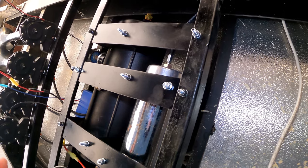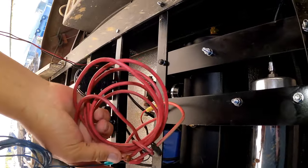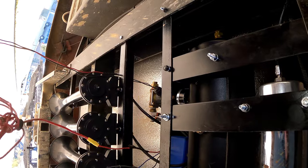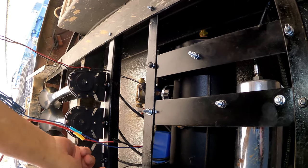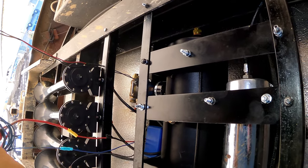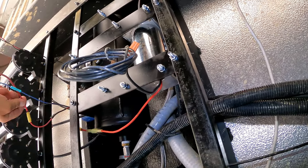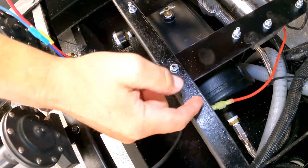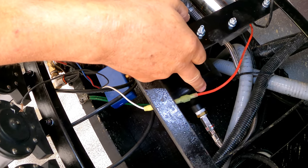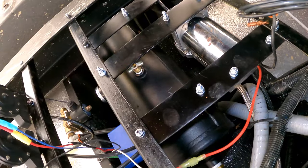Since it's a 12-volt system I really only need to run one wire for each thing. According to the schematic: red is the 12-volt positive, blue is the ignition wire so the compressor will not run when the ignition is off, and black is the ground. The power comes in and goes into the pressure switch — when the pressure drops below 100 PSI this kicks on, charging the system. Let's get busy putting in some plumbing and some wire.